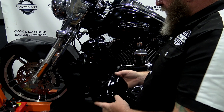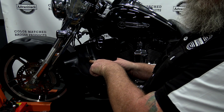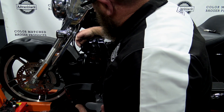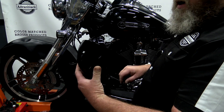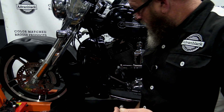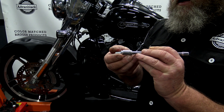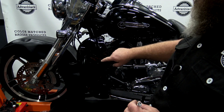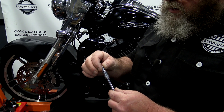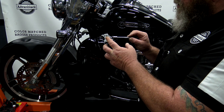With the speaker pod, it's a little trickier getting that 10 millimeter bolt back through that small hole and getting it to grab the little nut clip. You're going to need a 10 millimeter socket and an extension — poke it through that hole and have it come out the little hole in the back. We're going to roll this cap on and then tighten it down. One little tip: get a little bit of grease — this is just a red and tacky, you can pick this up anywhere. When you're running that bolt through that hole, it's easy for the bolt to fall off and fall back down behind the fairing, and then you have to take the whole thing apart to get the bolt out. If you put just a little bit of tacky grease on the end of that bolt and set it in there, it holds it in place.